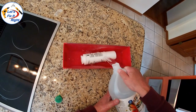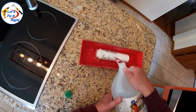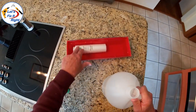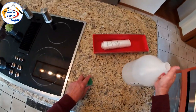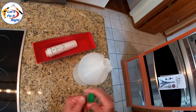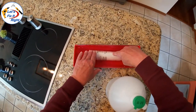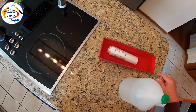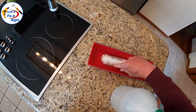The idea here is to use a container that is similar in size to your filter so you don't waste a lot of vinegar. Push the filter to the bottom so it is totally submerged. In this case, I used about a third of the bottle of vinegar, so the bottle would be good for about three filter cleanings and will last me approximately one year. I'll now let this soak for at least 24 hours.